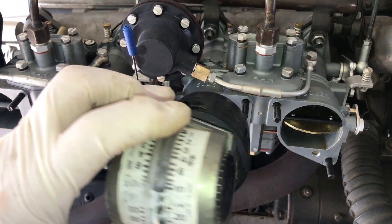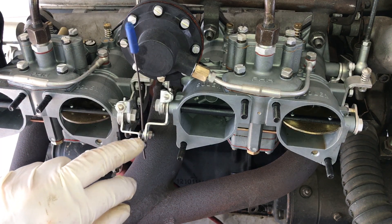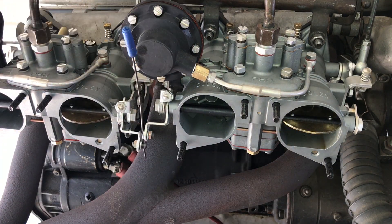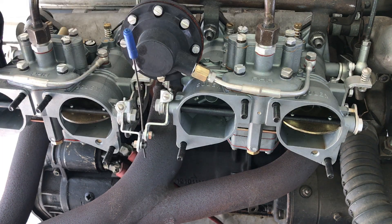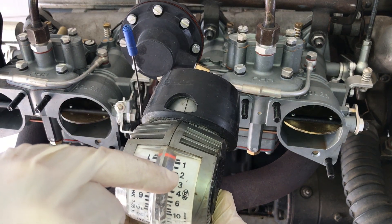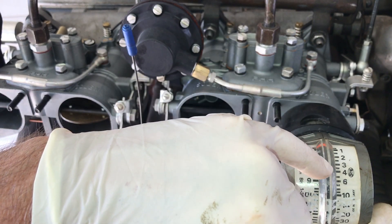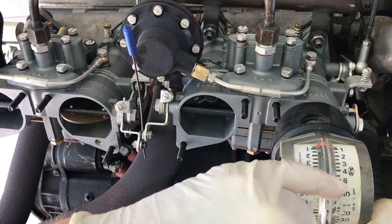I've got the synchro meter so we can synchronize the carburetors. The choke is tied together with a wire because this one just flops around compared to the other and it'll close on you while you're testing things. Without the air log you can see what's going on. When it gets warmed up, check your airflow — you want minimal airflow through the second barrel, two or lower on this meter, almost no air going through them whatsoever. The first barrel is what idles on and you're going to have a uniform airflow around five to six on the meter.